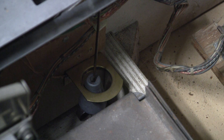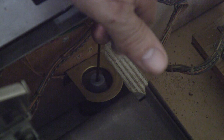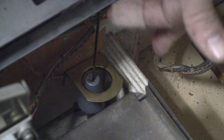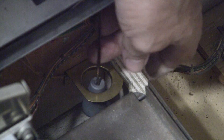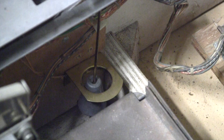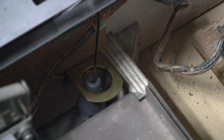Most people are familiar with the main tilt mechanism. As you see right here, this is an old electromechanical game called 300, and it's basically a pendulum with a lead weight on it. If you move the machine too much, this thing will wiggle around. There's a contact in the middle going to the lead weight, and the outer edge is the other part of the contact — so it's like a switch. When this touches the edge, that's a tilt.